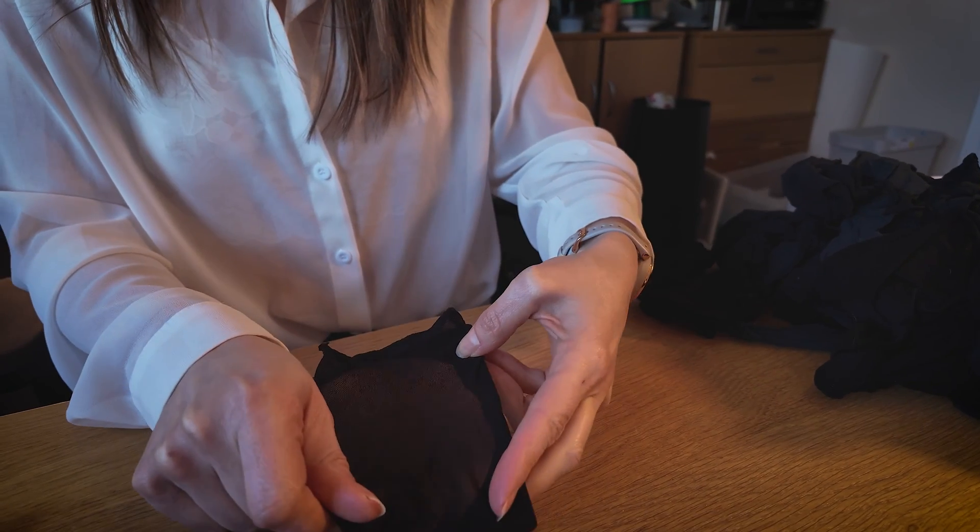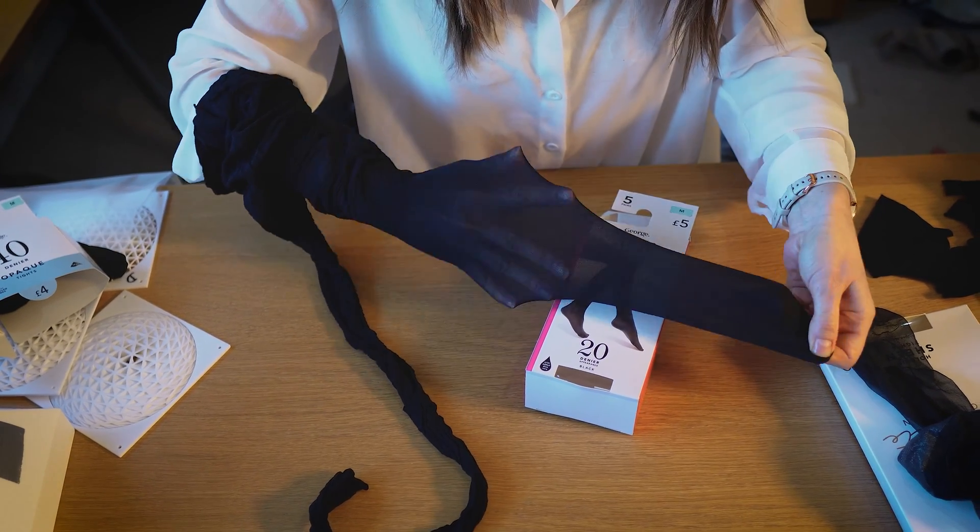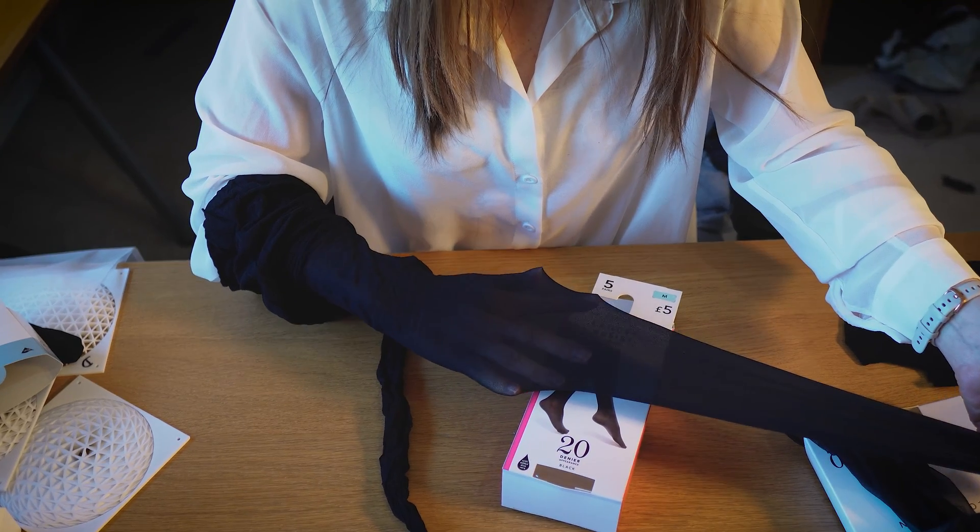I've got a hypothesis that there could be a difference in the elasticity of this particular brand, so I'll do more testing. But whether 10, 15 or 20 denier, they all perform great and very similarly. There's a sweet spot here between stopping dust, maintaining airflow, and how sturdy the material is. Given there's no massive difference, I'd recommend 20 denier - it's fine enough to catch the vast majority of dust particles, and it's a stronger material for the cost of just a few percentage points of airflow. These filters do have an impact, but it's not disastrous. Ultimately it comes down to a choice: you can just not have them and accept cleaning out the insides of your PC every few months, or you can include them. Personally, I'd rather have the extra time.